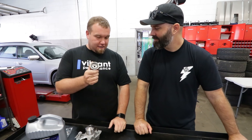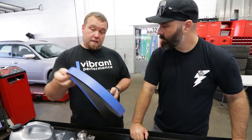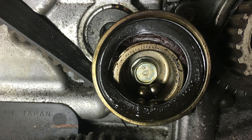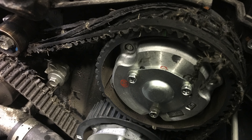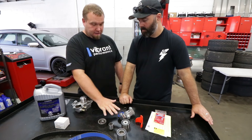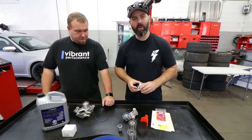This is the biggest problem with the EJ timing belt system. A lot of people will just go, 'I need a timing belt, it's 168K, I'll throw a belt on it.' A year down the road this thing explodes — all the bearings fall out of it and the belt comes off. Bad things happen: valves get bent and so on. The difference in price between the belt alone and the kit with everything is a couple hundred bucks. How much is an engine? Just replace it all — do it in one shot.